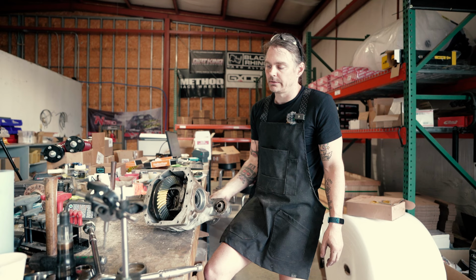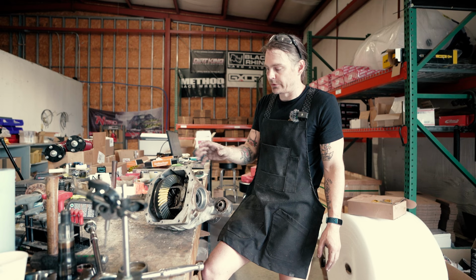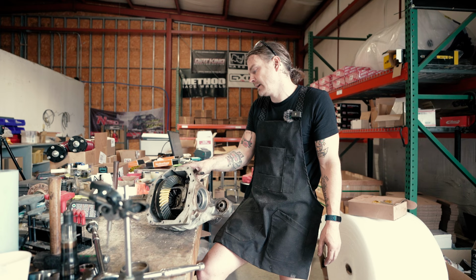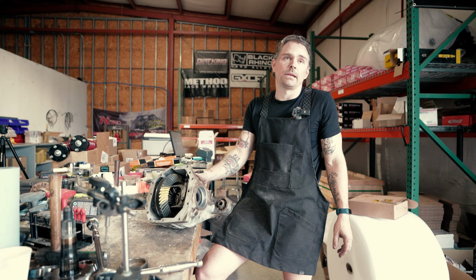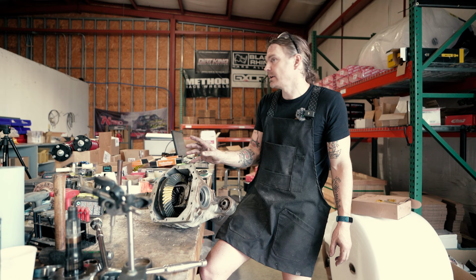Now, like we said earlier in this video, these are prototype gears. There are some adjustments that I had to make to the case here to make this fit, and it's gonna go on my truck. I'll be taking the 22 Frontier and throwing the M205 in the front along with V8 Pathfinder CVs. And then in the rear, I've got a matching gear set over yonder.